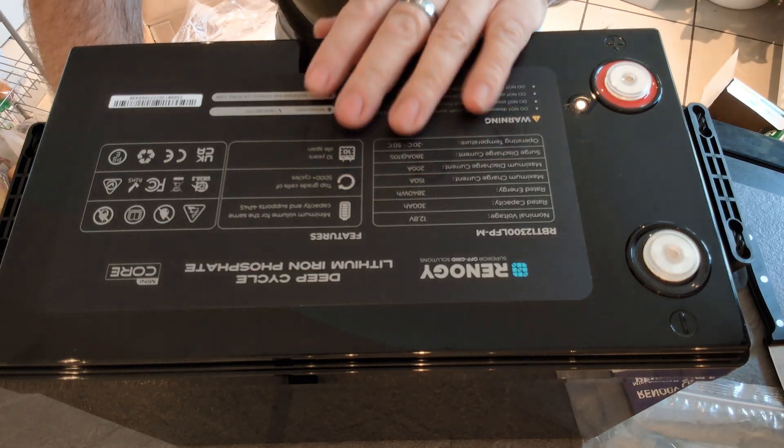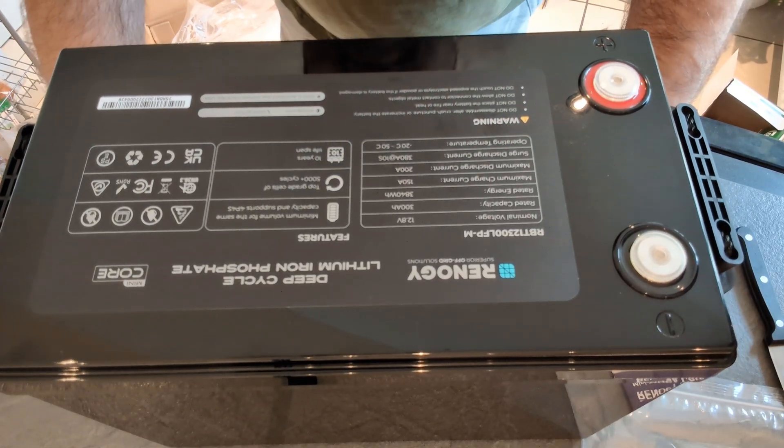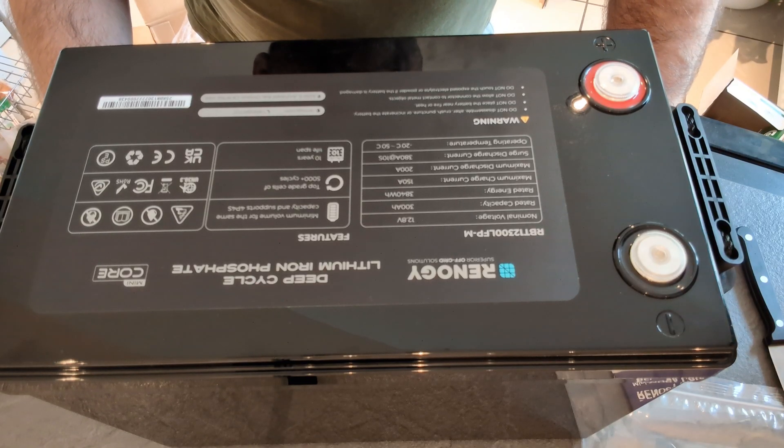This battery has low temperature protection built into it as well. So we've got a nice big new battery with really great specifications — but why have I decided to make the change now? The system I've got is operational and still works fine. I've never run out of power when I'm out and about on camping trips. What's behind changing it? Well, a lead acid battery doesn't really like to be discharged below 50%. A big advantage of lithium is you can fully discharge the battery without damaging it.